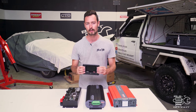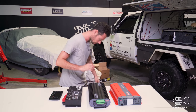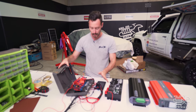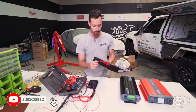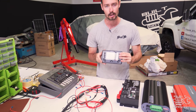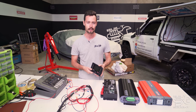And then this awesome panel system. What changes with the whole Redvision system is it gets rid of all your external relays and cabling. I've got the old system here — all this junk I ripped out of the canopy, with switches and inside just an absolute mess with relays. What's really cool about the Redvision is it's done for you. All you need to do is run cables in and out — it's got your earth and your power. Once the system's in, you have everything wired in your car, plug it in and you're good to go. It all gets operated from this nice switch panel, getting rid of these big chunky rocker switches. And the coolest thing — it hooks up through Wi-Fi or Bluetooth, so you can run it off your phone, sit in your campsite in bed and turn your electrical system off from your phone.